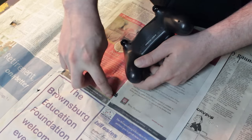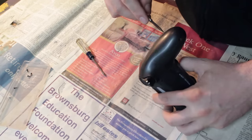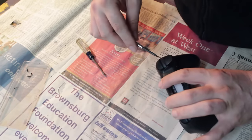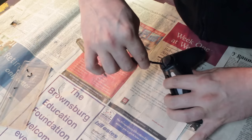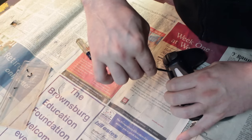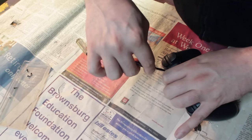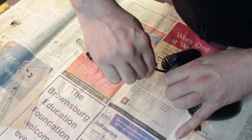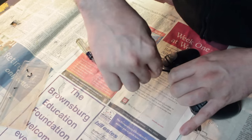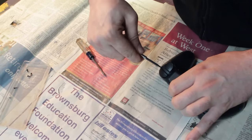So once you get those four screws out, I like to take a small flathead screwdriver and just kind of work my way around the crease where the controller connects to each other. It's two parts — this plastic piece kind of fits into each other and snaps into place. Using this flathead screwdriver, I'm able to work around the crease of that connection and pop this thing open.